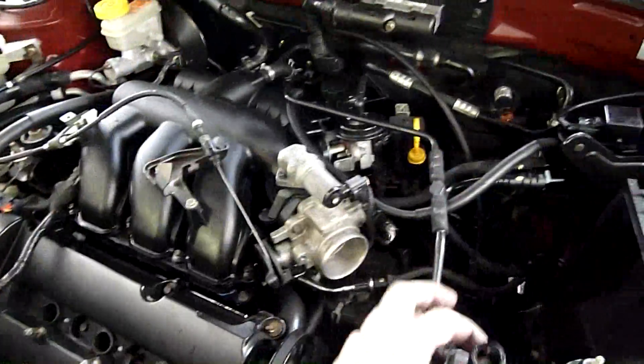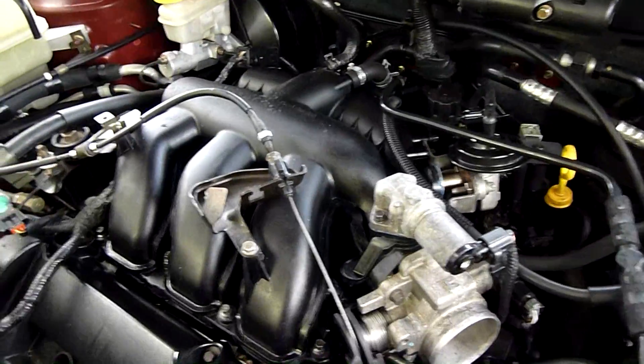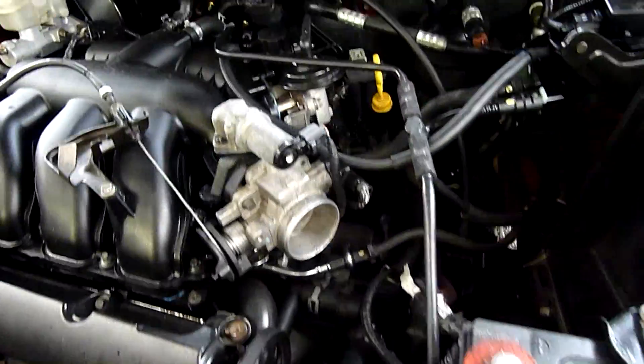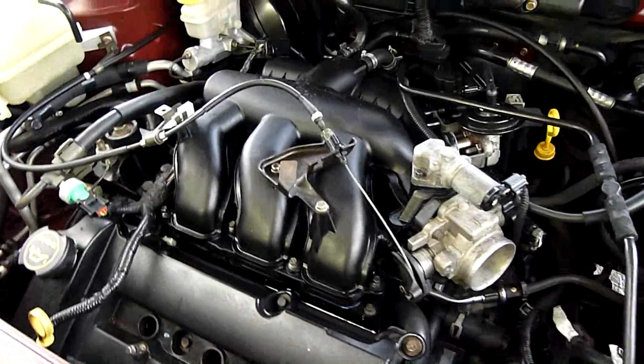Though I'd imagine I'd have uneven firing on all cylinders if that was the problem. Disconnecting the MAF meter while it's running - RPMs increase a little bit, but the missing still continues. So I don't think it's a combined fuel injection issue. I think it's isolated to these two cylinders, number four and number six.